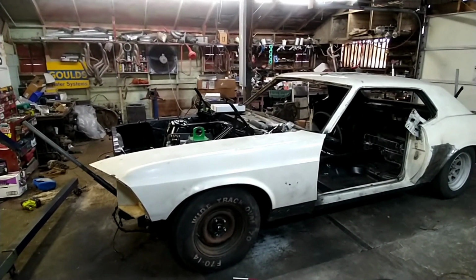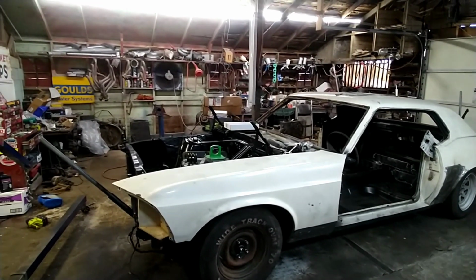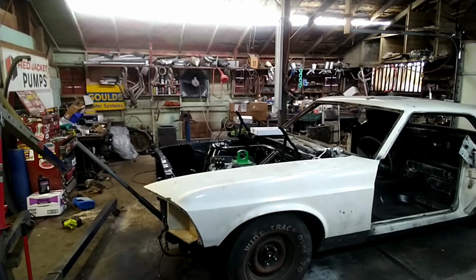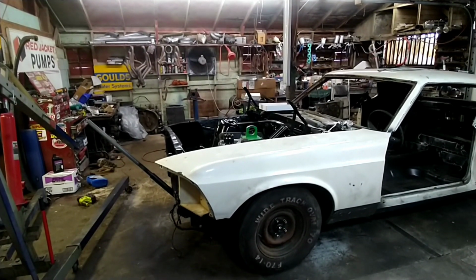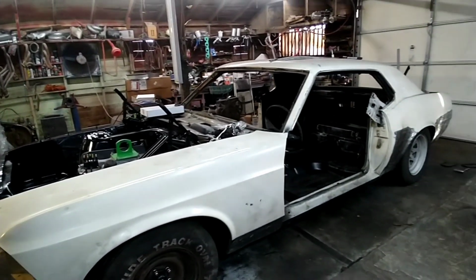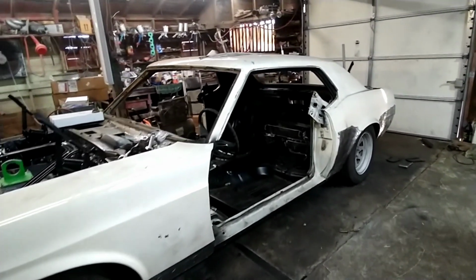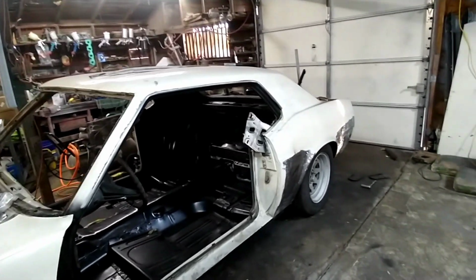The coilovers went alright, but in typical fashion, we had an issue. The threaded sleeve actually wound up when the weight of the car hit it. It, I guess, smashed the thread to where it just galled it down. Wasn't able to adjust it. So, if you are thinking about a set of these eBay coilovers, just spend the extra money. Get some QA1s. The only reason we didn't go with the QA1s is because the bracketry was separate and it was going to wind up costing more. But right now we're kind of on the search for some more sleeves that'll fit these shocks.